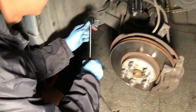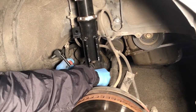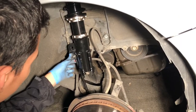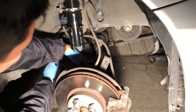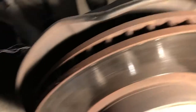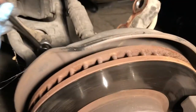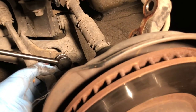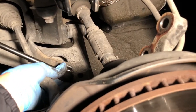These ones came with their own bolts too so you don't have to reuse the factory ones. Just put it through and put the other bolt on — make sure you don't cross thread it. It doesn't reach — the sway bar might be the issue. We believe the sway bar is causing it to not be able to reach, so we're gonna go to the other side and unbolt the tie rod on the other side to see if it'll let us move it.